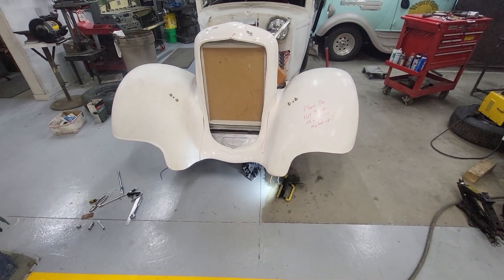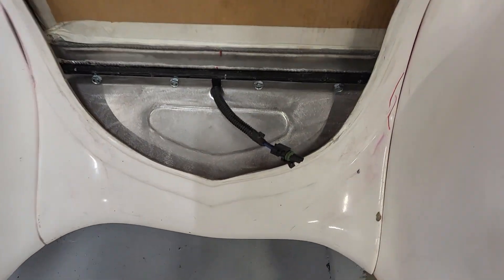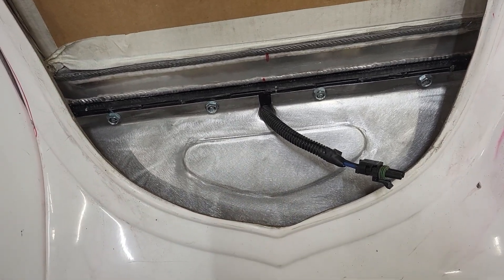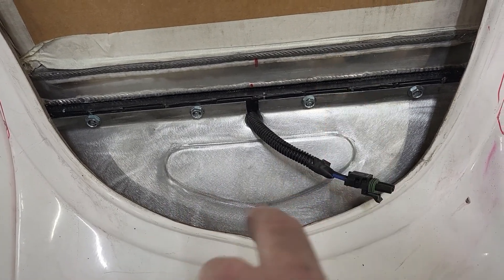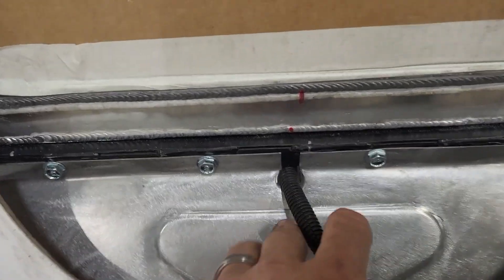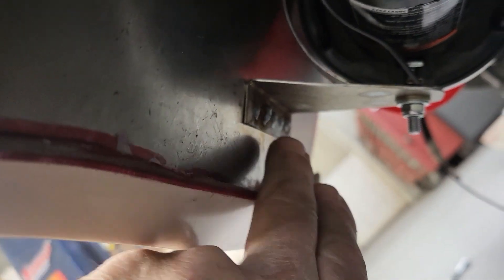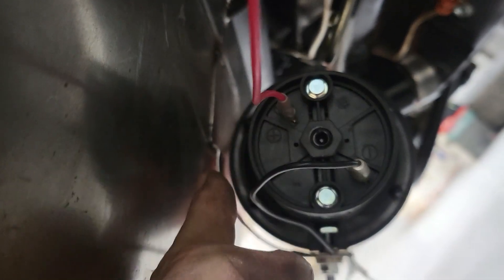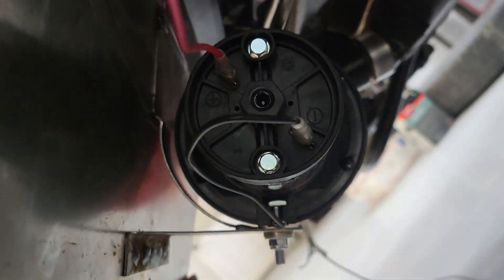Just a small snippet here — I did finish up. You can see I filled the hole where I had that horn screw in because I used it as a plug weld to mount the horn. I've got all that in. I just rolled a little hole here to not chafe the wiring — that's for the fan. Underneath, I plug-welded a bracket across the top rolling around the horn and now I've got a nice tight horn mount.